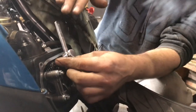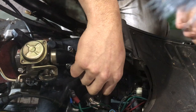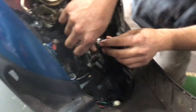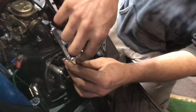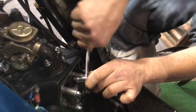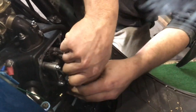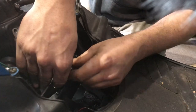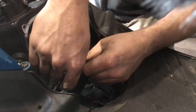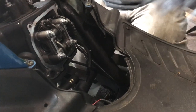You can do this with a 9 millimeter wrench and a crescent wrench. Loosen it up just a little bit, then hold the center while tightening — just like that. The bottom exhaust valve is the same way: loosen it up, turn it just a little bit if it needs it, and your valves are adjusted.